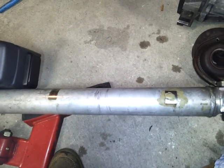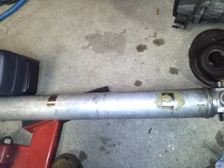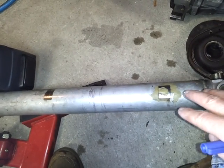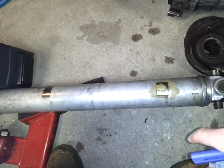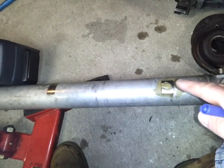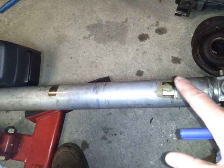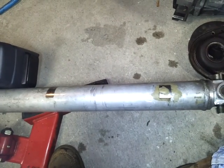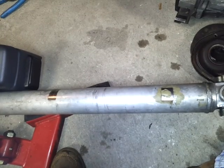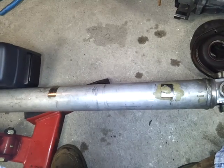Hello ladies, welcome to this clown's garage. In this video I will talk about drive shafts. This one here is an aluminum drive shaft. A lot of people are under the impression that aluminum drive shafts give you more power and can handle a lot of horsepower. Well, yes and no. This is a stock one — a stock aluminum drive shaft. It's thinner and weaker than the performance ones, so this won't handle a lot of horsepower at all. Be careful with that. If you start putting slicks on a car and it grabs, this will twist up like a pretzel.